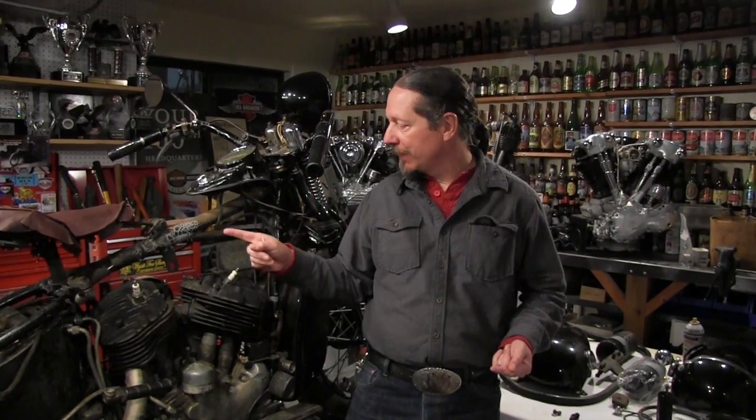Now, my buddy Jeff Kaufman at Jeff's American Classics up in Dundee, Oregon, chimed in and said, Jim, there are 3 versions that I know of. Jeff was very respectful and very humble in his comments, as he always is, and I appreciate that, but he knows way more than I ever will. Jeff says there's 3 versions of the 37 frame. There is an early 37 frame with a 7/8 inch reinforcement bar. There is a mid 37 frame that has a 7/8 inch reinforcement bar with 1-inch shims at the neck. And then there's the late 37 frame that has a 1-inch reinforcement bar on a 1-inch neck. This made total sense to me.